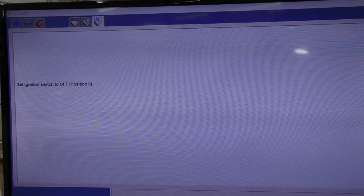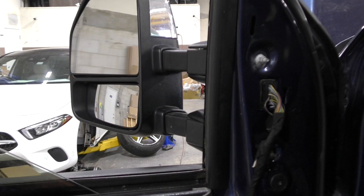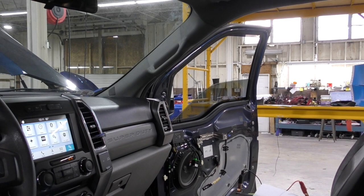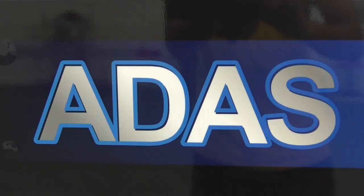After rewriting the as-build data, the module reconfigures. I turn the key off, it goes through the whole process — and now I press the button. Voilà, it actually works! It opens and closes. That means the module they put in came from the wrong car and wasn't configured for fold-in mirrors. The local Ford dealership had this vehicle for about three weeks and didn't find this. Thank you for watching ADAS Aiming by Jack Short — if you enjoyed the video, give me a thumbs up.